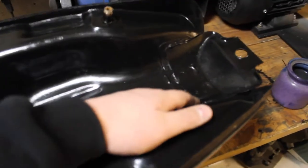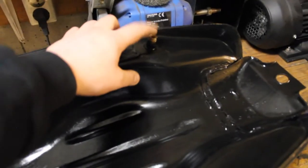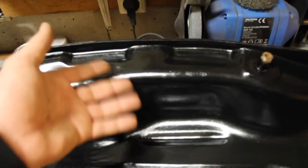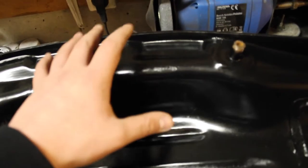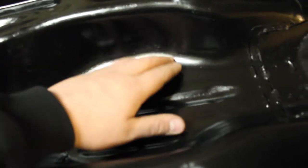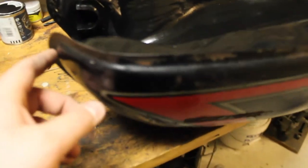The gas tank — look at that, nice and clean, black and painted. That's the petcock screw by the way. I went ahead and painted the underside of the gas tank, which was totally rusted — not deep pitting rust, but a lot of surface rust that was starting to develop into deeper rust. I know it's unorthodox to paint over the original paint of a 43-year-old gas tank, but it's the underside so no one really looks at it. I'd rather have a decent black finish than have the tank rust away.